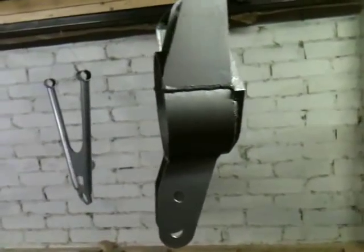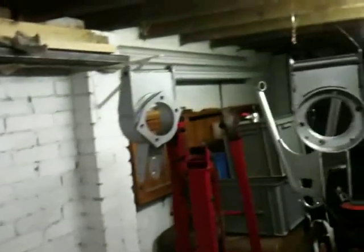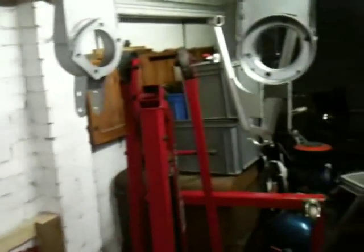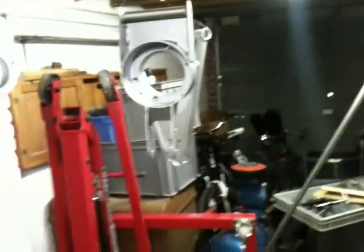Wishbones and uprights - painted, ready to go. I've epoxy masticed these with the one-to-one stuff in aluminium. This is not the aluminium finish - it's really dull, very dark grey, not very nice. It works very well, but I would recommend just going for black if you're going to get them and then paint them, because the aluminium colour is not nice. These, however, have been hammerited with two layers of silver hammerite smooth on top of the brush-painted epoxy mastic.